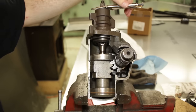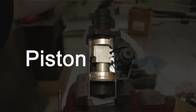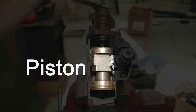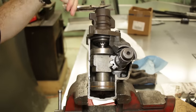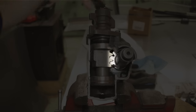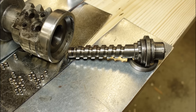Here we go, that's better. This ball lead screw turns with the steering wheel. As it turns, it screws in or out of the piston. Since the ball lead screw can't move up or down, it pulls the piston up or pushes it down — just like a nut on a bolt. This piston is also a rack, and the output shaft is a pinion. As the piston moves up and down, it pushes against the teeth of the output shaft, causing the output shaft to turn. If you're wondering why it's called a ball lead screw, there are ball bearings inside the piston. So instead of the lead screw using threads to turn against, it uses these ball bearings. This reduces the friction required to rotate the lead screw, increasing the efficiency of the system.